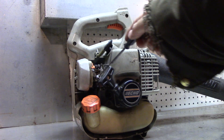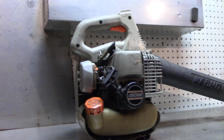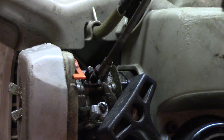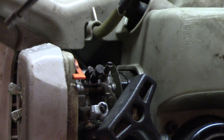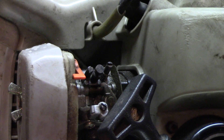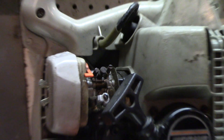This is probably just the high speed. Let me zoom in a bit. The low speed is always towards your intake, and the high speed is always towards your air filter - pointing away from the engine. So I could technically just address that high speed and this thing will be fine.